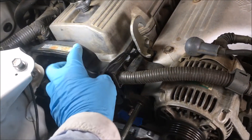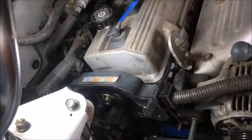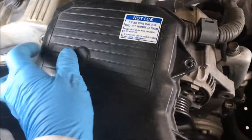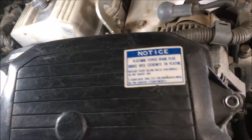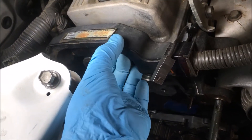Our electrical bundle here is already off. Yours will look like it's right up next to the side of this valve cover. To remove it, on the upper timing belt cover there are two bolts — one and two right there at the top. You just loosen those; you don't have to remove them. Loosen them and pull this up out of the way.